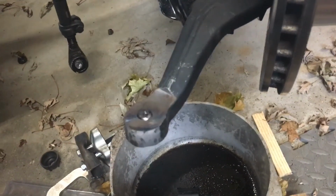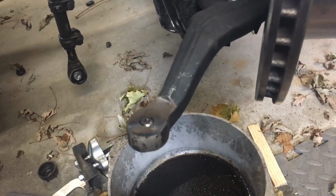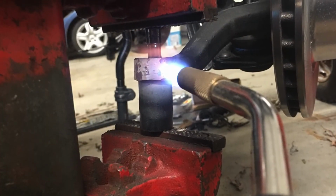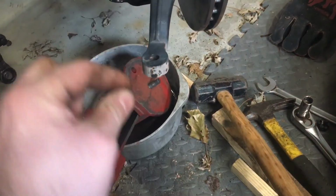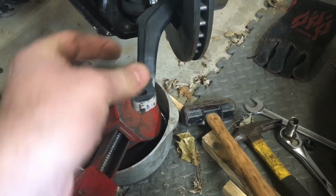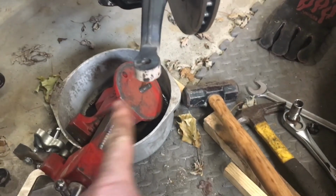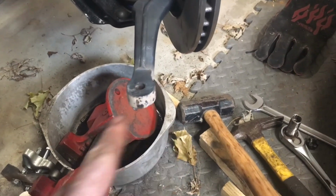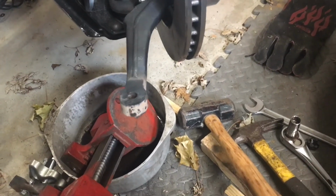Thing just will not die. My camera will not. I was sitting on the floor here and I had the vise up on there. So I had a small socket on the top of the taper and a big socket on the bottom, and then the vise gripped onto it, and then I started heating with the map gas torch, and it heated for about 6 minutes before the thing just went pop, and the damn thing fell on my foot and hurt me.